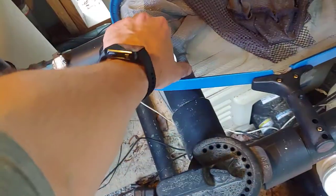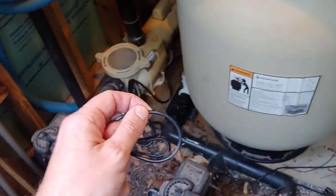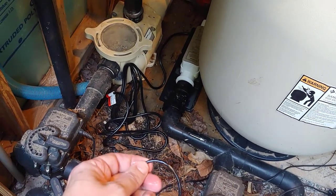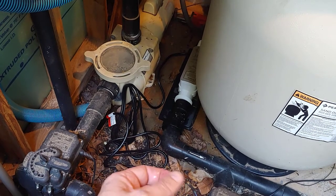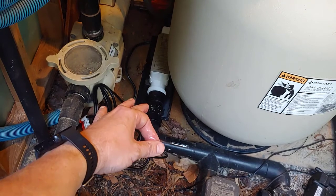This is what I mean by silicone — there's a Magic Glue brand but you can get this at any home improvement store for three or four bucks. Just get some on your fingers and rub it in. It goes into a groove on the black part. To get out the old o-ring you might need a small screwdriver — you don't want to mar or gouge the new one. It goes on the black side into that groove, then you hand-tighten it.